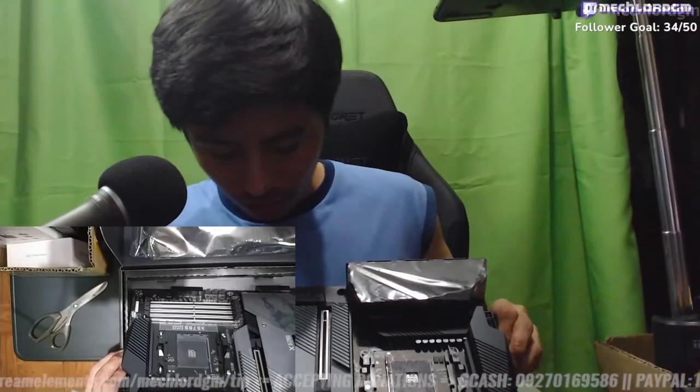Yeah, the reason I bought this, I did mention it, but now I'm going to point it out, is because it has two PCIe 4.0 slots. You can see the whitish slots right there. Those are the PCIe 4.0 slots. That's the reason why I bought this one. If you bought the Elite, the model lower than this one, there's only one slot. So that's how you differentiate them in Gigabyte's lineup. The Aorus Elite has one PCIe 4.0 slot. For the X570S chipset, the Pro has two PCIe 4.0 slots, and the Aorus Master, the best one, has three.